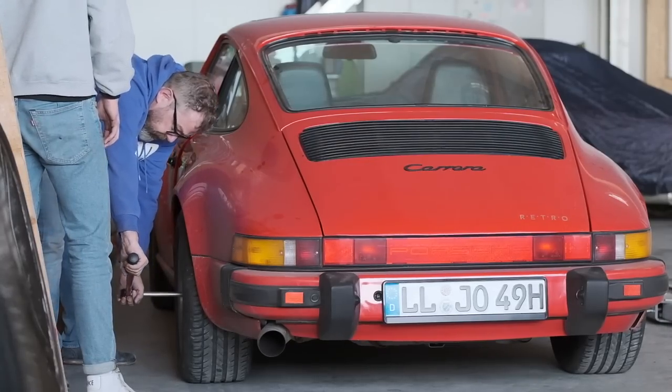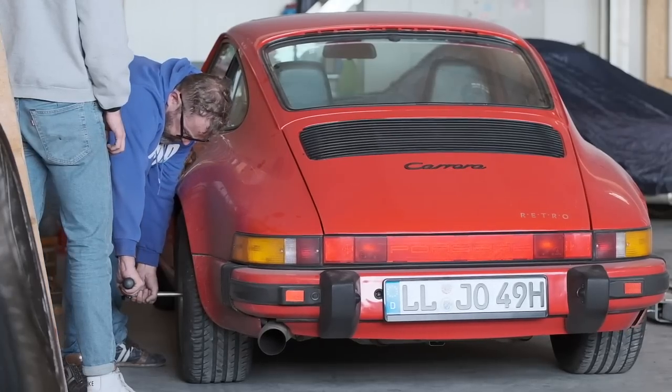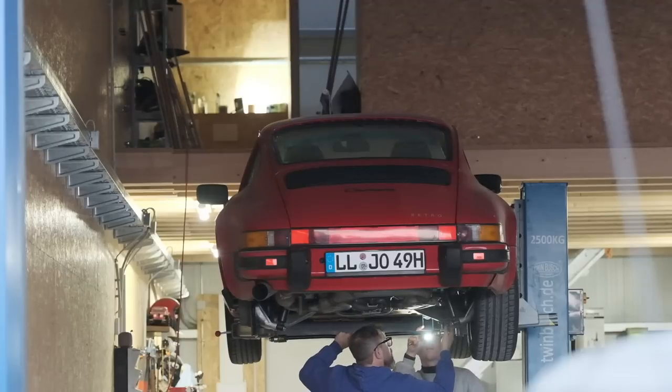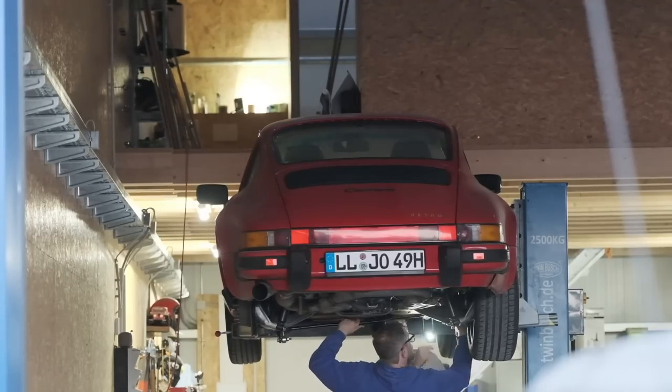In this year of construction, between 300 and 460 Nm are required to tighten the nut responsible for the bearing preload. This is a hell of a lot of torque — some solid breakfast is recommended.